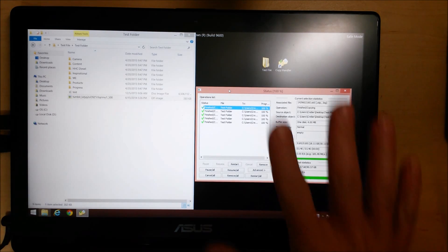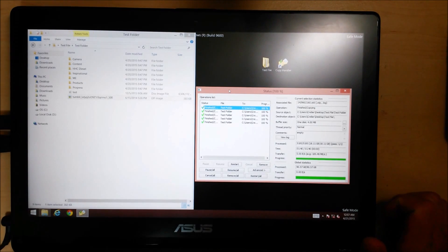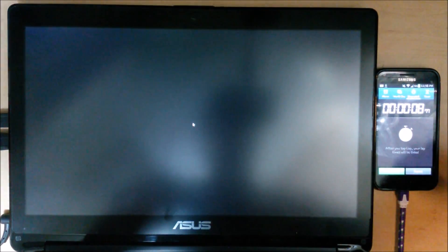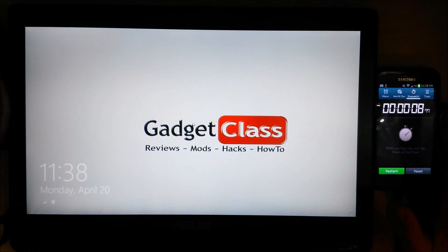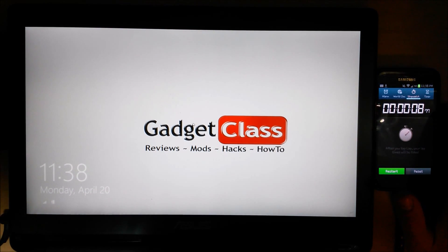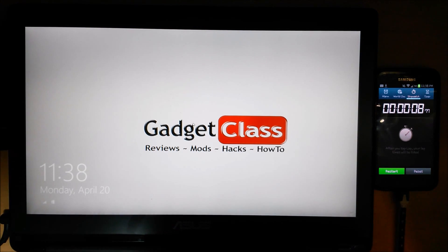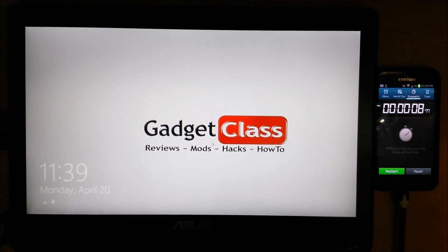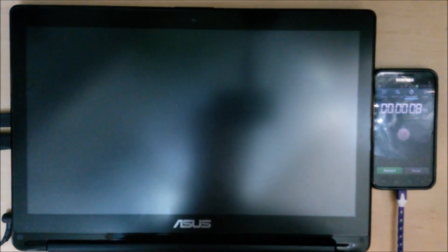I'm going to go by the benchmark graphs on this one. I am doing this in safe mode as well, to delete as many variables as I can. Startup tests are kind of hard to do because the only really effective way to get a startup time is to use an external timer and press the power button at the same time you start the timer. To account for that, I've done an average of 20 startup tests for each drive. The Samsung 850 EVO was actually faster by 0.49 seconds — basically half a second faster. You're not going to notice it if you buy one of the Crucial drives, but for those who like performance and value, you're going to get a better deal with the 850 EVO.